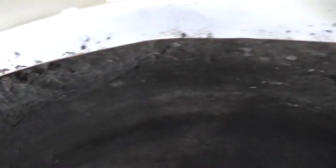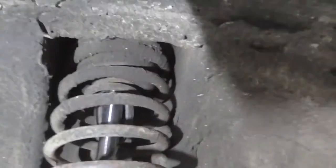So that's the wheel arch near side front — a little bit of paint come off, that's fine. Getting under the wing there, near side front wing — I hope you can see it, it's absolutely perfect. Original springs there, blue markings on them. Right, so the offside front now. So that's under there, there's no corrosion of any sort. Just again a little bit of paint wearing thin. You can see the original spot welds there on the wing. There's a little bit of paint just flaked off and started from chips, but again nothing untoward.